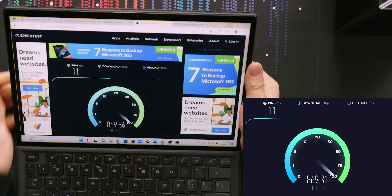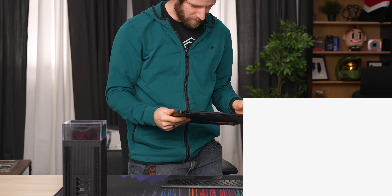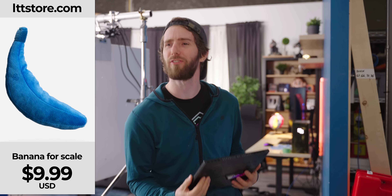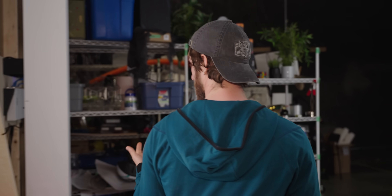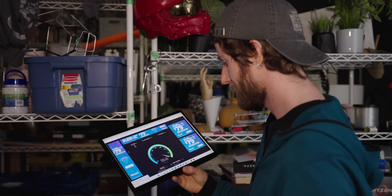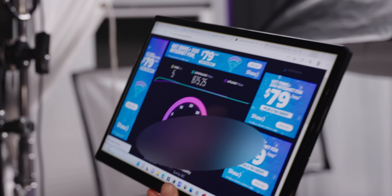Urban fiber's not better today. I mean, 6 GHz is probably not gonna do that great at distance, but let's go on the other side of a wall and see — is it gonna get completely annihilated by one wall? Nope. Okay, let's find another wall then. This is not what I expected. We now have a good solid couple of walls between us and we are still doing nearly 900 megabit per second.